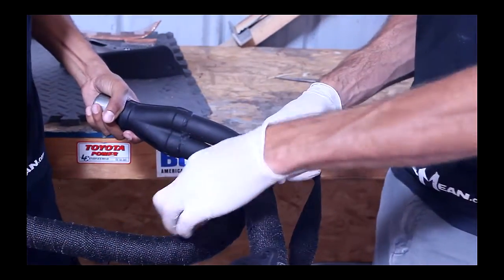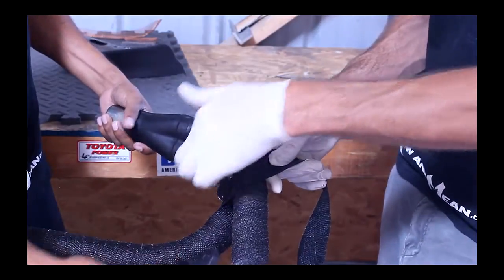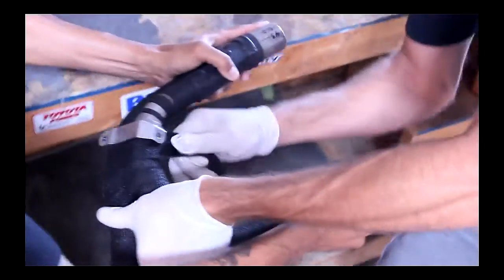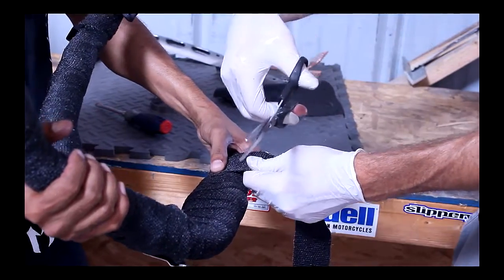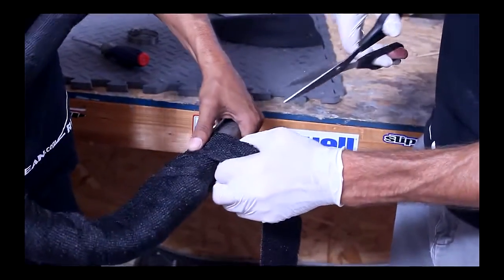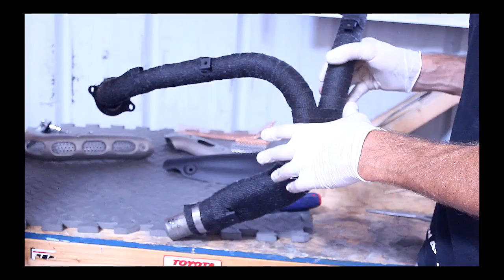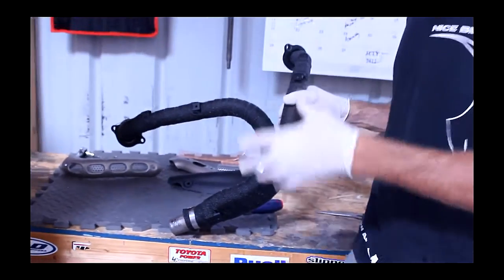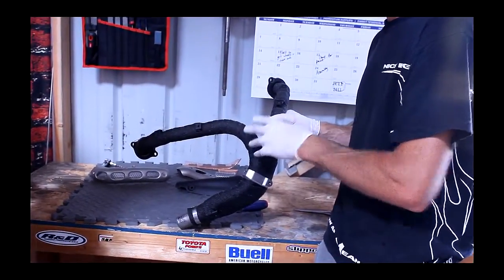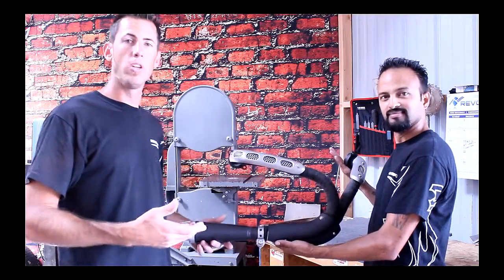We've now wrapped the rear header and we're coming to where the rear header meets the front header. At this point, just in front of this clamp, we're gonna double-wrap both headers together — it's too tight to individually wrap the two. We've wrapped all the way around the two pipes to the very end, right down to the weld, and we're gonna install a clamp. The idea is not only to reduce the amount of heat but also to improve performance — you'll see this on drag race bikes and aftermarket custom bikes.